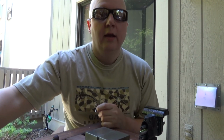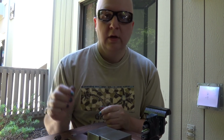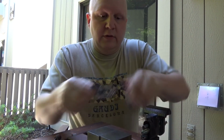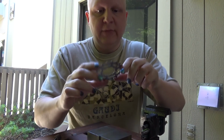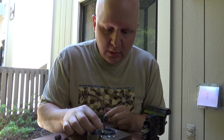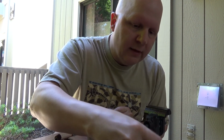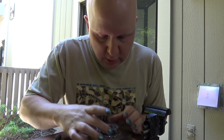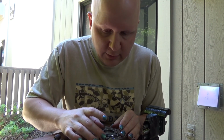Hammer! So, now what we're going to do is we are going to actually assemble these cogs together in the correct order. These glasses off for now. And in the correct orientation as well. So that's important. So, you want the bit with the stamping side up. And you want to do it in the correct order. So, I'm going to do the 19, I think it was. Yeah, 19. Thanks for honking. 19, the 17, and we want to make sure to line up the narrow notch in the correct place as well, so it'll actually fit onto the free hub body once we get to that point.